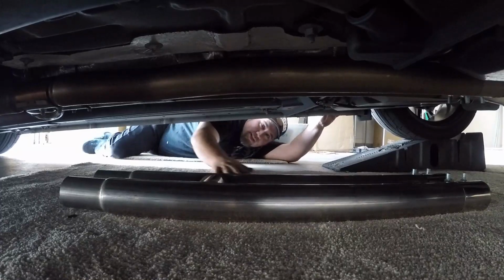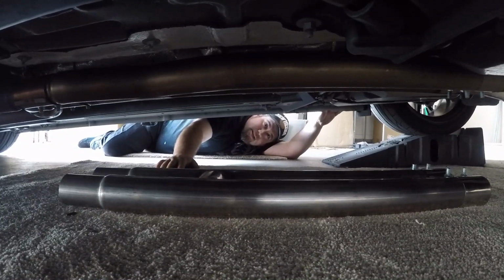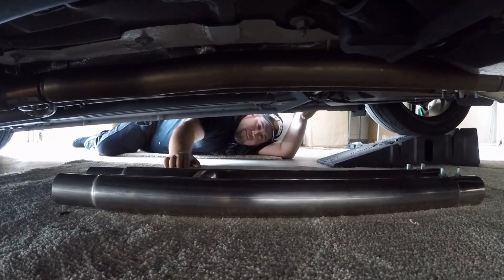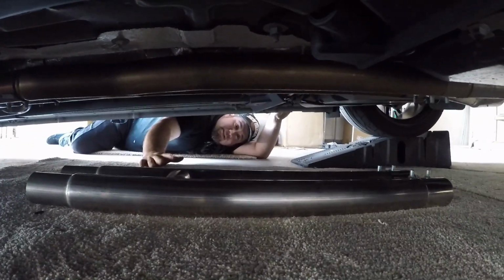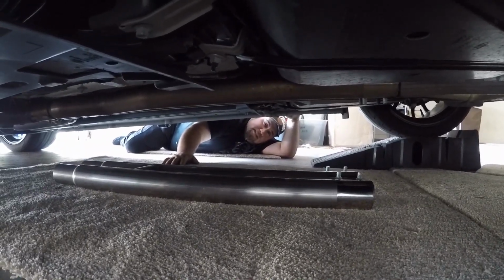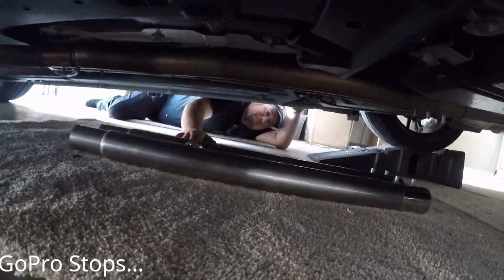To avoid this situation, because the X-pipe is longer than the H-pipe, it's better to cut than to add. Yeah, it would have been better if I'd gone with the H-pipe, but then I probably wouldn't even be changing the mid pipe out. But the X-pipe is excellent. It sounds great. It's just I'm trying to get some deeper tone out of it. You just change up the sound a little bit. I've had raspy S550s for a couple of years now. My last one had the Corsa Extreme. It's loud, but I think Steeda has a really refined sound and a nice tone to it. So yeah,